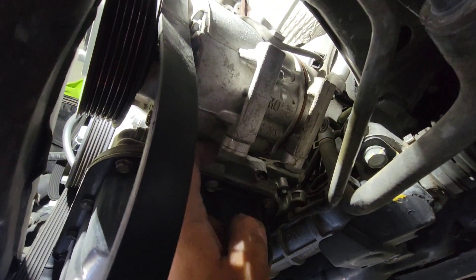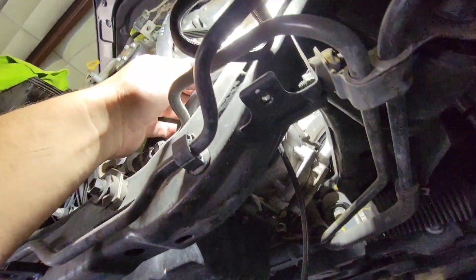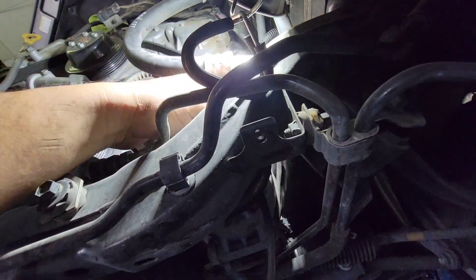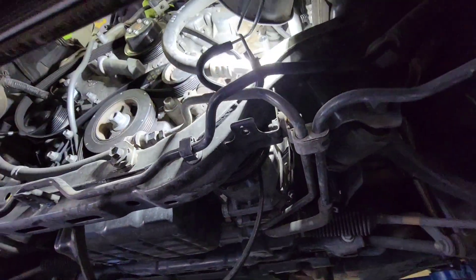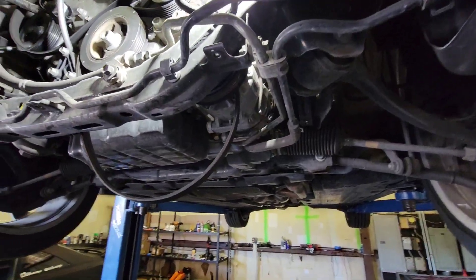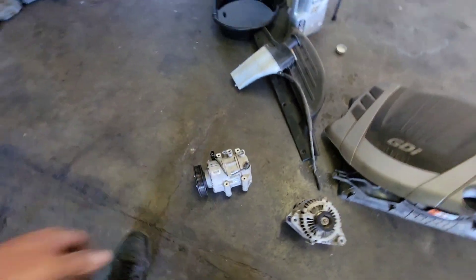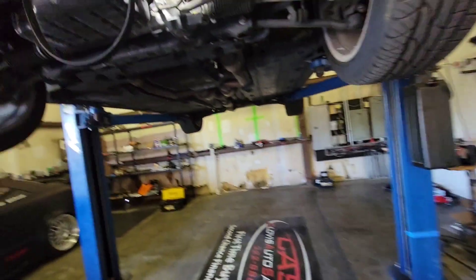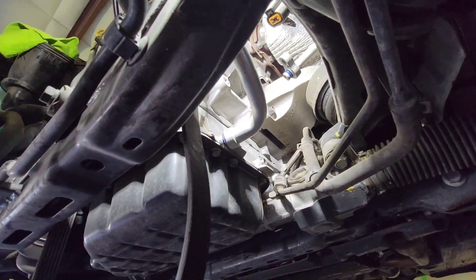Just work it out — I'm going to need both hands. Just kind of pick it up and slide it out. It does have little guide pins there. We might be able to pull it out from here, but I'll definitely need both hands because it is pretty heavy. And there it is — that is how we remove the AC compressor on this Genesis.